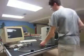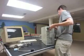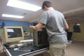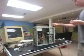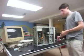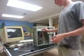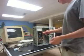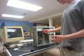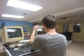Now you want to connect your power supply to your motherboard, and your drives to your motherboard as well, and your case to your motherboard as well. So we'll start with the power supply to the motherboard and the drives. Same thing as you did in your preliminary build. Take the main power supply plug and connect it to your motherboard.